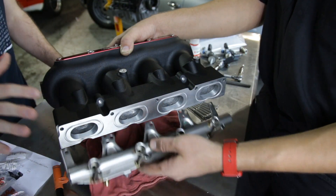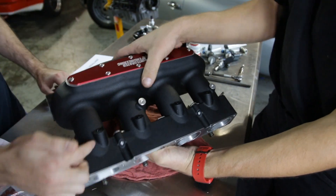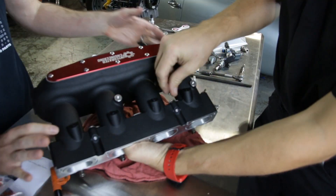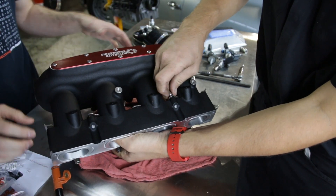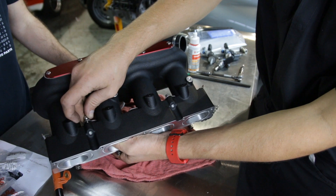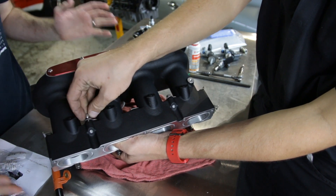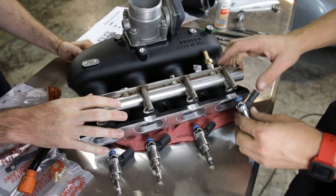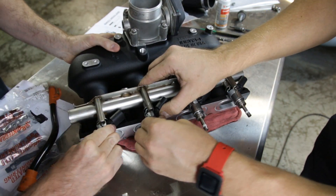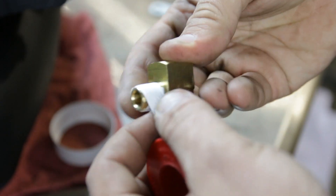So now we're ready to install our fuel rail onto our manifold — it just flips on underneath like that. One note: all of these had to be filed down to clear, because obviously the runners are bigger, so getting it actually installed on here and mounted in place took some modification and filing. A lot of times when you go through a build like this you will have to modify things to make everything function properly together. Now our rail is all mounted in place. We're going to install our RS4 injectors — we have the seals lubed up here to make it easier to get those installed. Now we're going to install our Teflon tape on all of our mounting hardware that goes into the manifold for vacuum fittings, to ensure that we have a good seal against the manifold and don't have any vacuum leaks.